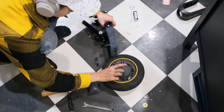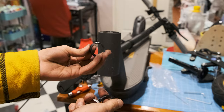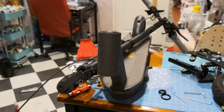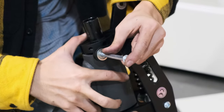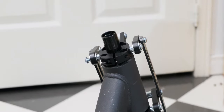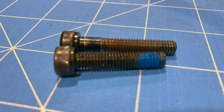Anyways, the wheel can now be screwed onto the suspension — make sure to use a permanent Loctite solution when doing so. If you go back to the neck of the scooter, you will see two black rings sitting on top of each other; we do not need those. Instead, use the silver ring provided by the kit. Now insert the suspension into the neck, then insert the shaft into the upper neck part of the suspension, sandwiching the spacer in between. Once done correctly, it should look like this.